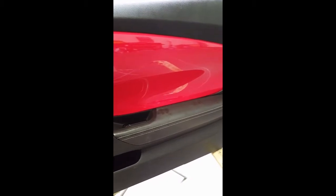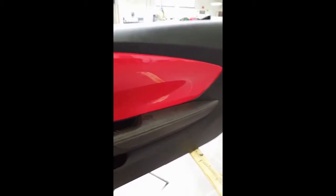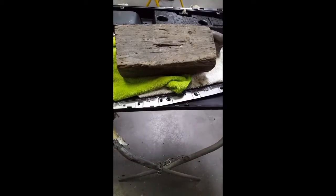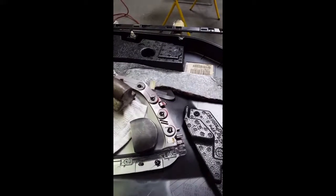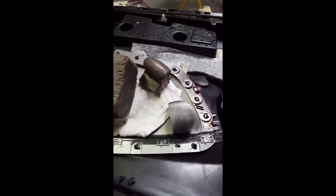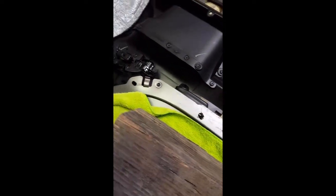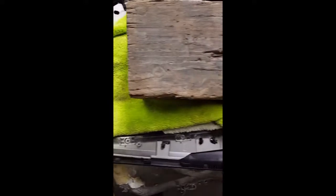There you can actually see the SS arm pad. So let's get this bonded together and get this door panel put back in. Now what I've done is I've used a 1-minute structural adhesive and basically re-riveted the panel, and then added some weight to keep it held down in place while it sets up.